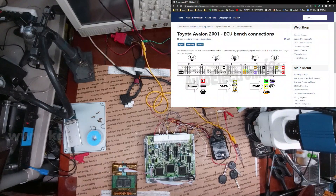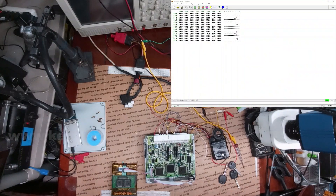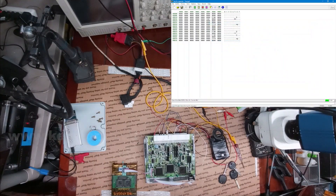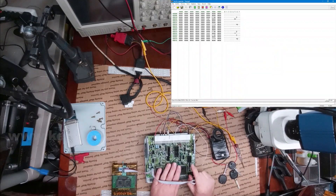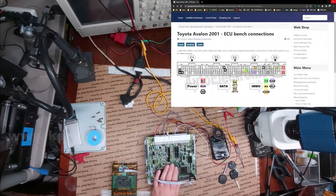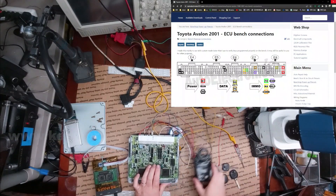Let's get back to business. Let me open up Orange 5 — I've already loaded it but I'm going to load it again and compare what's there. I do not have a great clip, which is one of the reasons I don't like clips too much. I am going to write this virgin file here — I'm going to compare it. And we are done with that. Now I have our virgin file loaded and we're going to begin to program the keys.